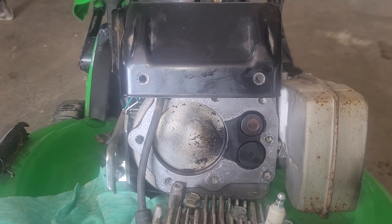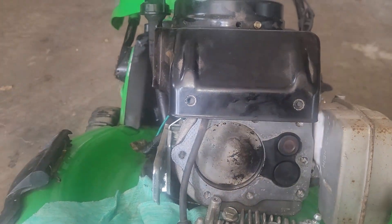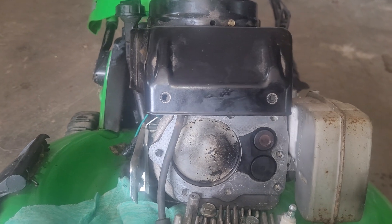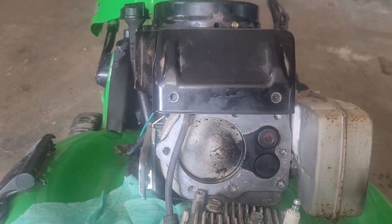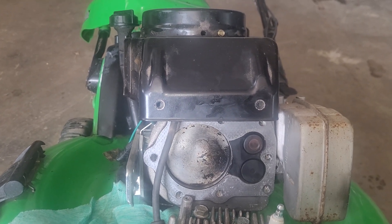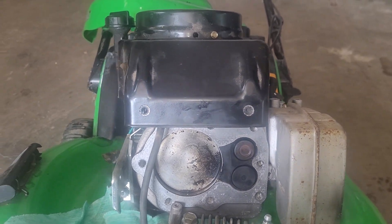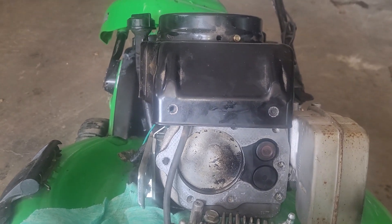These videos won't come out until after July 21st — it's around the 16th today — so that's pretty much it for this push mower. This video probably won't come out until August. I likely missed the good opportunity to sell it this season, but it's not working properly so it's not worth selling right now. If I have to hold on to it for another year, that's not a big deal. I'll put it back in the shed. To summarize: it runs for about 30 seconds then dies, new carburetor, replaced the coil, disconnected the safeties — still does it. Please subscribe, comment, keep it redneck — bye for now.